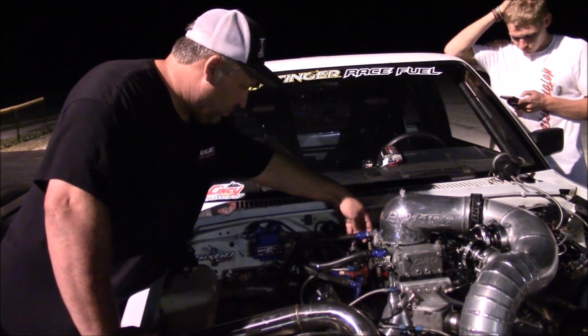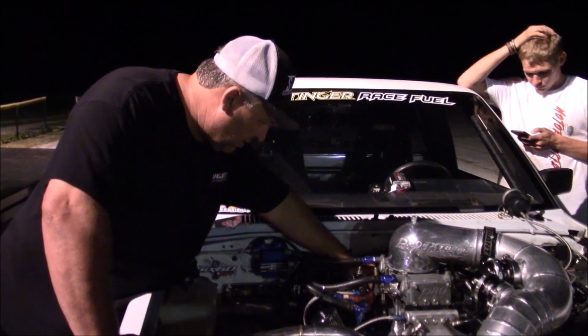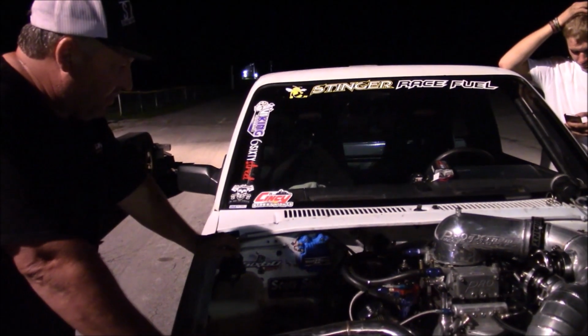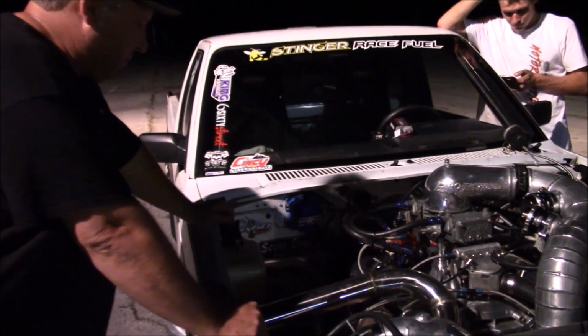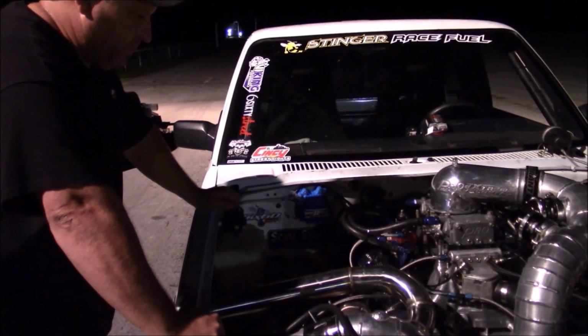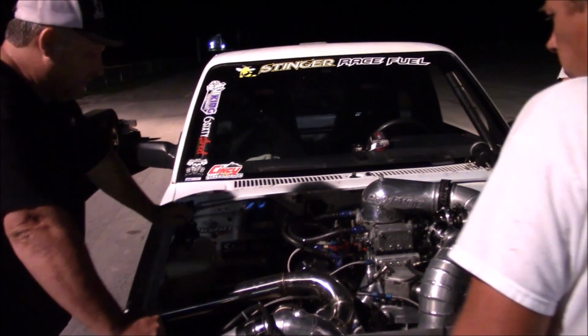The ground for the ignition box is right here on the carburetor stud where I can keep an eye on it. Right. And it's tight. Usually you got a heavy ground coming off the starter somewhere. This one doesn't have anything. It's just on steel motor mounts. Oh. But it's still worth running a 4-gauge cable. Usually I run it off one of the starter bolts. That's the highest current consumer in the engine.